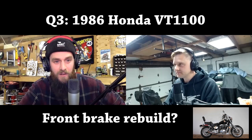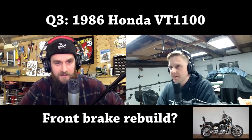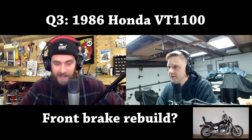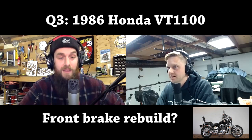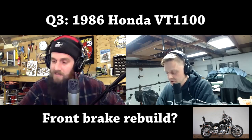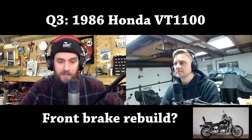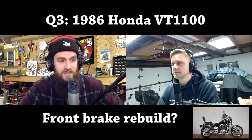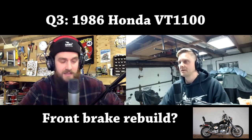Future investor. Better answer this one good. That's right. So the answer is he needs to rebuild his front brake master cylinder. 100%. How about the caliper? Absolutely. Yeah, all of it. And if that has the hydraulic clutch, which I think it does, you need to rebuild that one too, and you need to rebuild the slave cylinder. Because they're probably all the same age. Yep. When you crack that front brake open, or that clutch, or those calipers open, you're going to find the nastiest looking muddy muck inside there, and it has to be spotless.